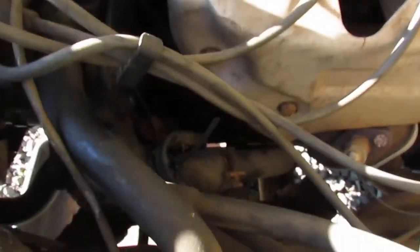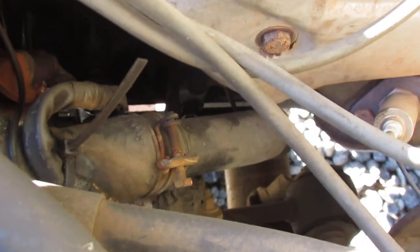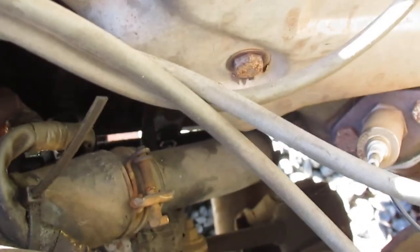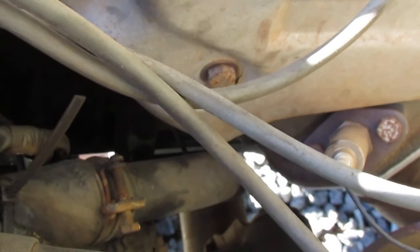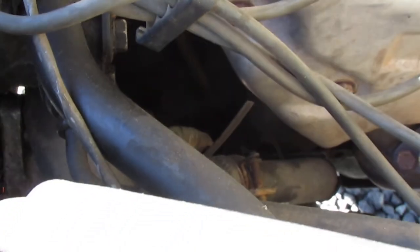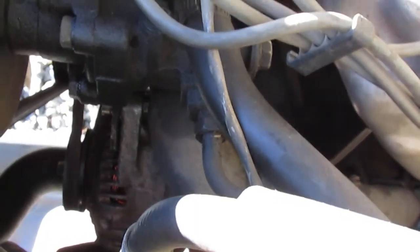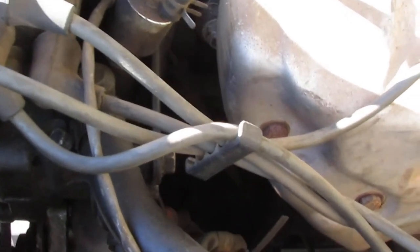Eventually it's probably going to need a motor replacement, but for now it should be okay. This is the pipe I'm going to be replacing — that metal part with the hose sticking off of it — and I'm going to need a new one of those upper hoses. There's a new lower hose already on it. They were telling me there's a bypass hose somewhere in here, but I'm sure I'll find it when I get to it. All this has got to come off. I figure what I'm going to do is flush the cooling system. It's got something in it — I'm not sure if it's stop leak or what somebody put in it. I might have done it myself; my memory sucks. So I'm going to try to flush all that out of the block first. I'm going to leave the hoses connected, take the thermostat out, and just run water through it until it flushes clear.